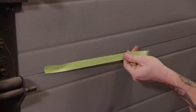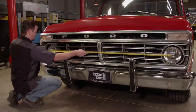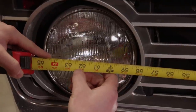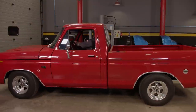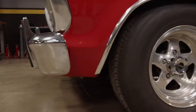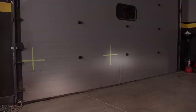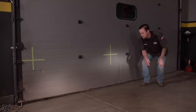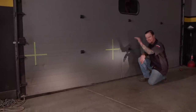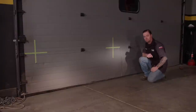Next, we need to make a vertical mark at the center of each light — ours are 62 inches apart, so we'll make a vertical line on the wall at the center of each headlight. Then we'll back the truck up perfectly straight so the lights are exactly 25 feet from the wall, kill the shop lights, and see how ours line up. What we're shooting for is to have each beam pointed at the targets, but the hot spot should be a couple inches below the mark. The driver's light is way too low — that's definitely going to hurt vision at night. The passenger side is not that bad; it's just set over to the right a little bit, so we'll make a few adjustments.